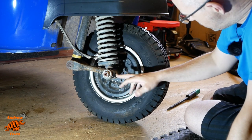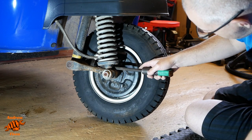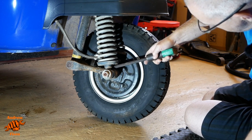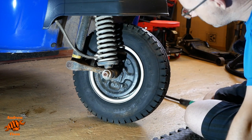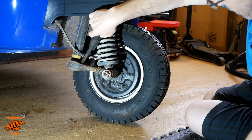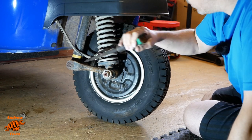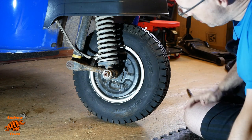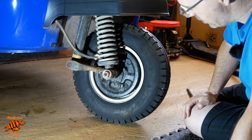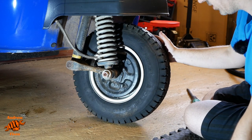Then have a look at the bushings. There's one here which looks perished and horrible from the outside, but actually if we give it a bit of leverage there's no movement in it whatsoever — so that's absolutely fine. If these are really bad you'd know from driving it, but applying a little bit of pressure with a lever can just identify if there's any play in them, and there isn't any. While you're here, have a look at the wheel and the tyre — although we're going to jack it up in a minute.